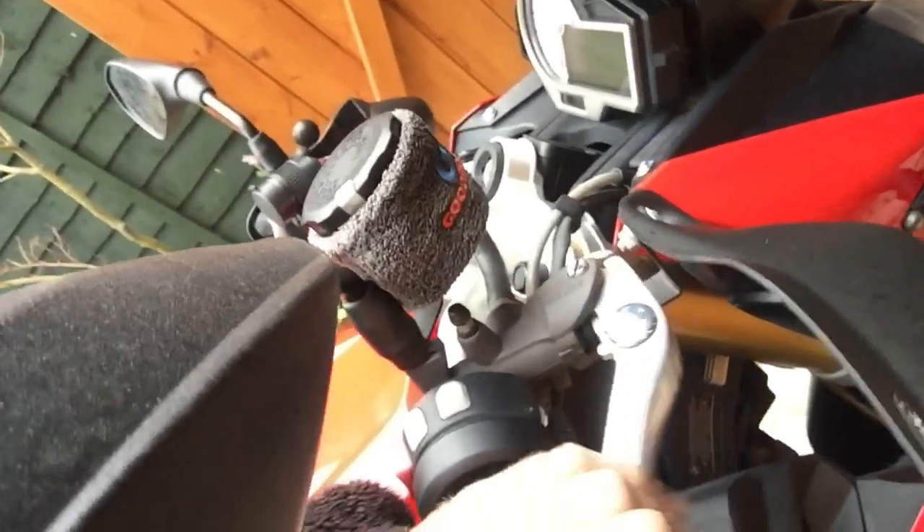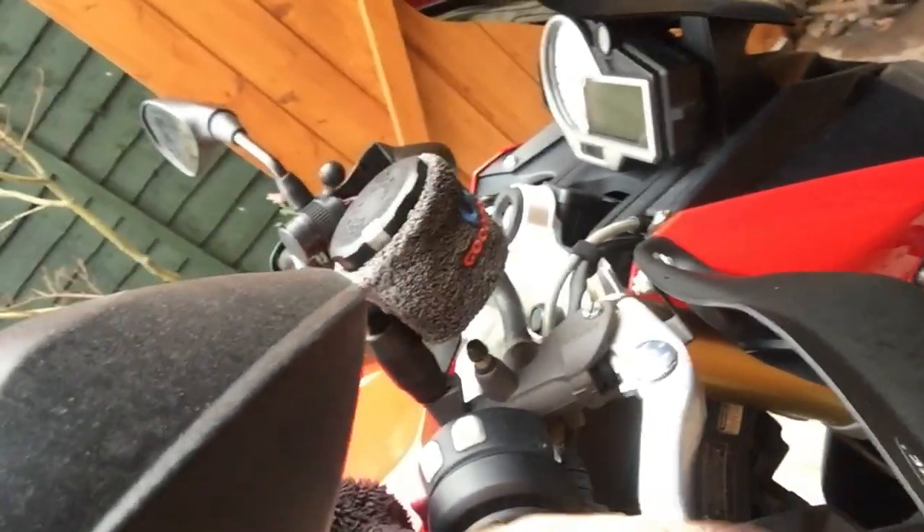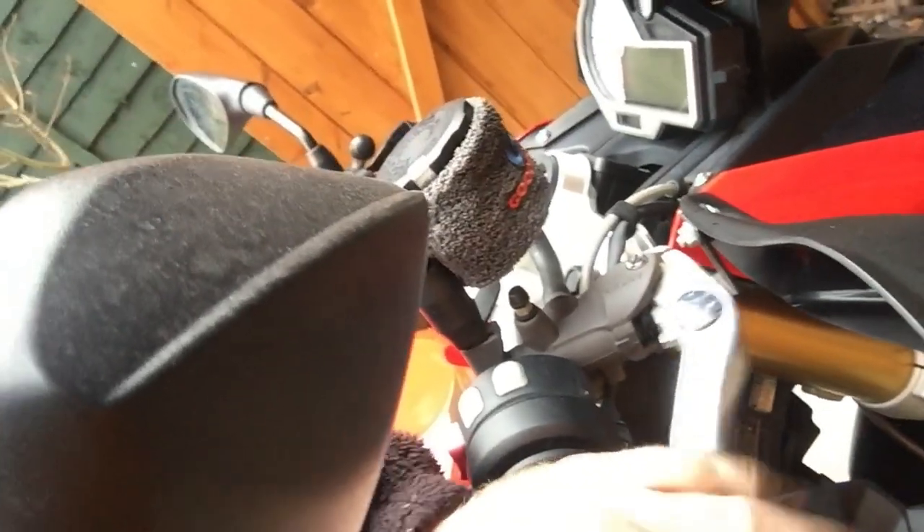That's the gist of how I changed my front brake pads on the BMW S1000R. Before you go out, you need to give your front brake lever a good few pumps — you can see how slack it is. Pump it until you feel the pads bed up against the disc and it feels nice and firm. Then just be careful on your first couple of runs — make sure you bed them in nicely, usually about 100 to 200 miles. Job done, thanks for watching — take care.